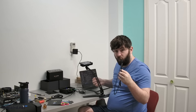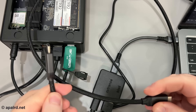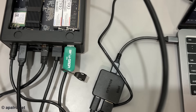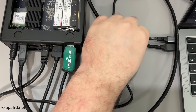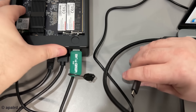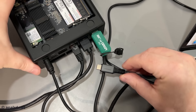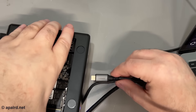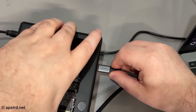One of the neat features of Thunderbolt and USB 4.0 in general is you can plug two computers directly into each other and they should be able to talk over Thunderbolt. This does not work with normal USB 3.0, but for Thunderbolt it does. I've got a cable here — I'll plug this in. It's so stiff. Thunderbolt on that side, laptop on this side. Nothing at first — tried plugging it back in, then tried a 10 gig cable. I don't even see it in dmesg. Let me try the front port. My laptop is charging, so something is working.